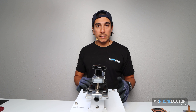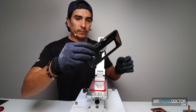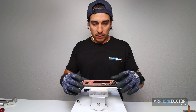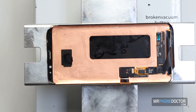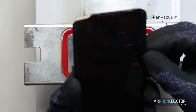Let me show you guys the other feature on this machine — being able to cut the glass. First, you want to drop the temperature down because the OLED is going to be facing down. Let's take a look at how clean the pull was. We removed the arm and we'll be using the other function. You can see how universal this tool is. Once you get it off, set it here and just cut away. It just pulls the screen down — this is not going anywhere. We'll make our little entry point, release, take a look, make sure we're good — and we're good.